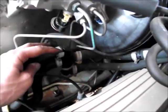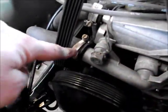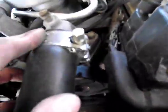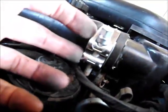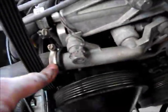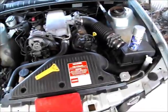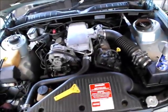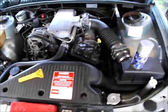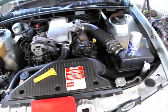These mild steel galvanized hose clamps are really firm — throw them out, every single one of them. There are maybe a couple of good stainless ones on the car, but I suggest you go buy T-clamps. I use them on trucks and earthmoving equipment; you see them on performance cars a lot. Good quality stuff. If you're not going to buy those, at least buy good quality worm drive clamps — stainless steel, really flexible. If the clamp looks like it's had the living crap wrung out of it, throw it away. Don't reuse crap on cooling systems.